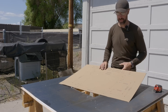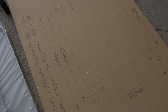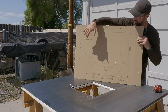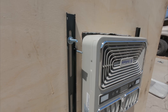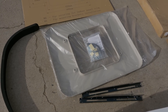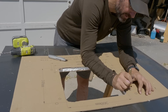In the installation kit you're going to get a template that will help you drill the necessary holes. You have the 14-by-14-inch opening, but there are additional holes that need to be drilled — four of them are for the brackets that actually hold the air conditioner in place, and two are for the interior trim piece. We'll get the template cut out, lay it out, and then drill our holes through the mock-up roof.